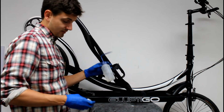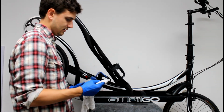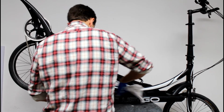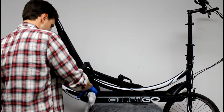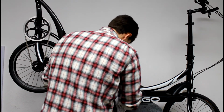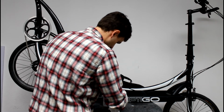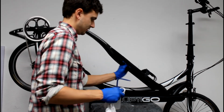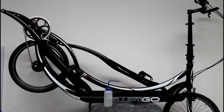Usually I have a little squirt bottle full of alcohol, and a rag. You just wipe down the track insert. Get any little bits of dirt, wax, or whatever that were on the track off. Also just check the surface of your load wheel, wipe it down, and recheck it. And keep doing that until it sounds good.